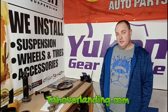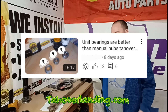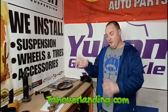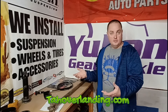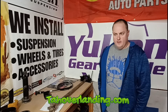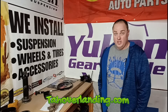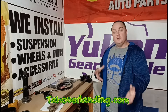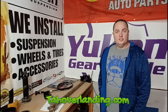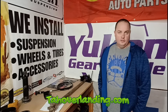As I showed in this video, manual hub axles - even the Dana 60 manual hub axles - have smaller bearings at the hub than we have in our unitbearing assemblies. So why go for the weaker component when you have a better option and can use the hub assemblies you already have on your truck? It's cheaper, you get to keep ABS because that's got the ABS sensors built into it, and it's stronger. Also, it doesn't have any additional rotating mass over a manual hub axle.